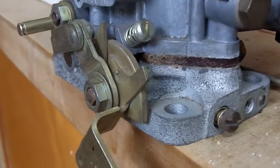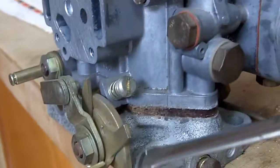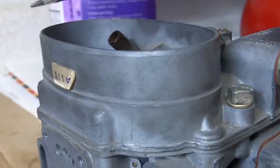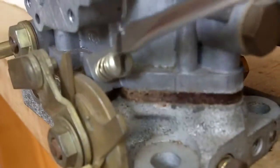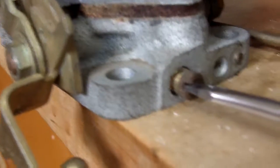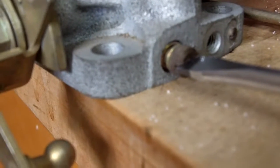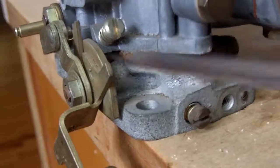Once you get the car started and running with all the linkage hooked up, you then pop the linkage off and start your tuning. As I mentioned before, you're going to be using your synchro meter up here, and this is what you use to synchronize idle — which is essentially airflow between the two carburetors. Once that's done, you come and do your idle mixture screw: screw it in until it bottoms, then back off one and a half turns. Those are your two initial settings, and those are the only settings you get to make. Thanks.